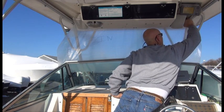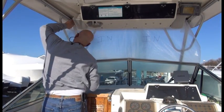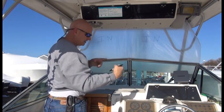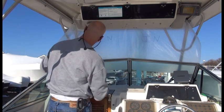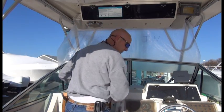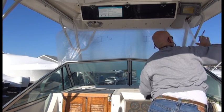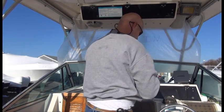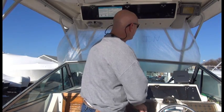And then I put a little hash mark right where the awning rail stops, and then a cutoff mark right in between where the two pieces of awning rail come together. I'll put a cutoff mark right in between the two where I know where I'm going to put my vertical zipper to connect the sides. And that is it. That's exactly how you mark out for this very basic front curtain.